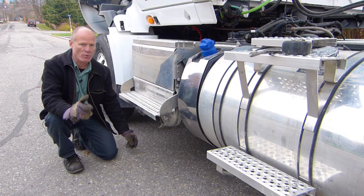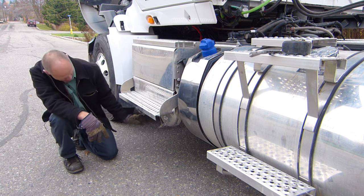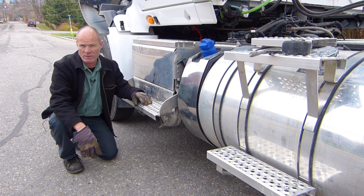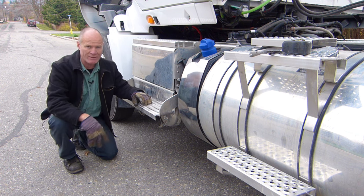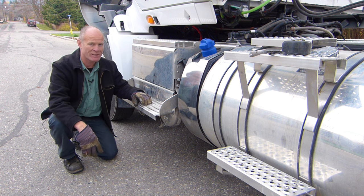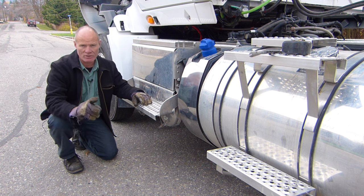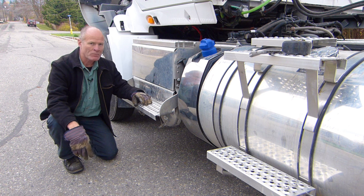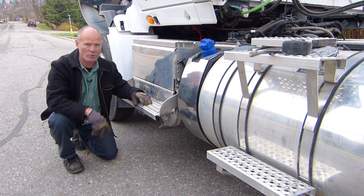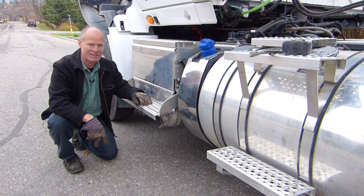For the pre-trip inspection you have to test the air tanks. The air tanks on this truck are underneath the step, kind of tucked up underneath here — oftentimes they'll be up underneath the frame. On a pre-trip inspection for air brakes on an older model that doesn't have an ADIS system, this one has an ADIS system so it only has a primary and a secondary tank — it doesn't have a wet tank. The older models will have a wet tank and the first step is to drain the wet tank. To find the wet tank on an older vehicle, you go in the cab and take note of what the pressure is on the two pressure gauges, because you only have pressure gauges on the primary and secondary tanks.